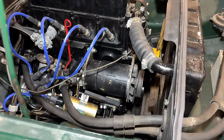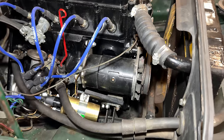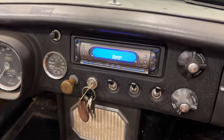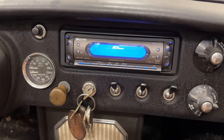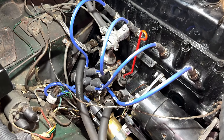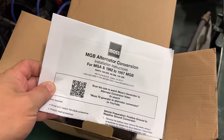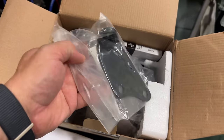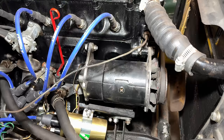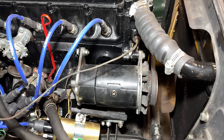I think one of the next reliability upgrades you would want to do on an MGB is to replace this old generator with an alternator. Depending on what year your MGB is, this will also mean that you need to convert it to negative ground. If you convert your car to negative ground, you can run a modern stereo, all of the lights on your car will be much brighter especially at idle, and you will have cheaper and more options available for ignition upgrades. This is the kit that I bought for the alternator — it's the same kit you would use on an MGA. We have the alternator itself, some brackets, all the bolts and connectors we'll need, and it even came with a new belt. I'm going to disconnect the battery and take the generator out, and then I'll show you what the brackets look like that held the generator in that we need to remove and replace with different ones for the alternator.